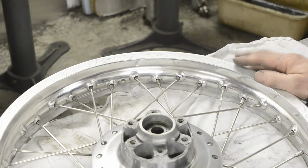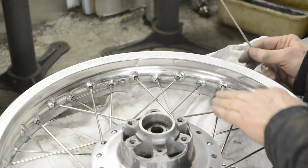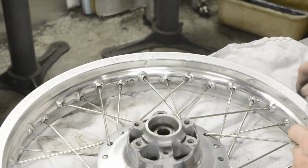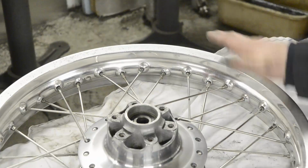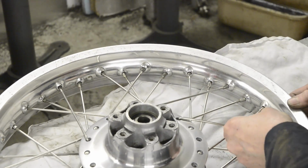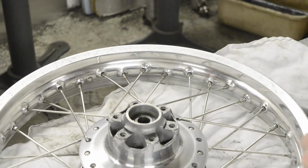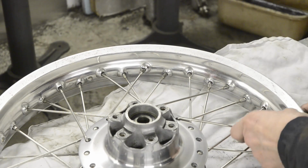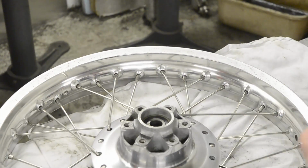Now when I show you truing with the dial gauge, we're looking at thousandths of an inch. So if you've been, as I have, out here sanding, you've probably made this rim, although it's perfectly round, little hills and valleys, and your pointer will go mad and you'll think, why can't I get this true? And it's because the edge of the rim isn't true, or isn't flat. So any of you that are just changing spokes and using your original rim, bear that in mind.